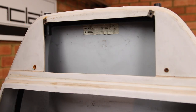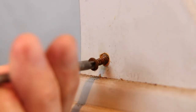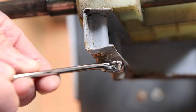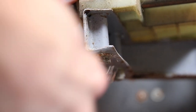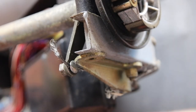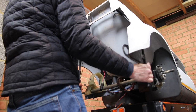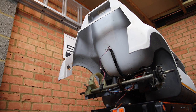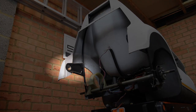Take out the two screws that fasten the body shell to the rear metal support — or rear location frame as it's referred to in the Sinclair documentation. Remove the bolts left and right that hold the rear location frame to the chassis. Charles from the C5 user group got in touch to say the frame was incorrectly installed — the metalwork should sit inside the plastic body shell.